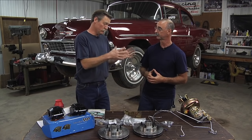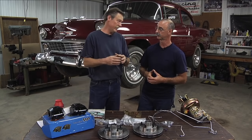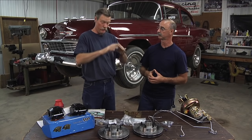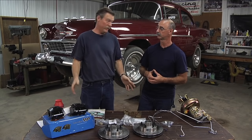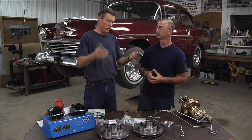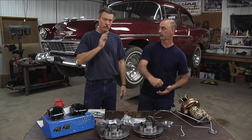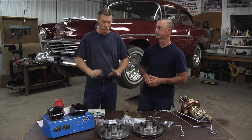A lot of the older vehicles — well, all the older vehicles — had single reservoir brake systems, which means if you lost pressure for any reason anywhere in the system, anywhere in the brakes, you lost all brakes. They were gone, except for your emergency brake, which may or may not work. So you blow a front brake line, you step on the brake, all the fluid is going to pump out that hole — it's gone, you have no brakes at all.